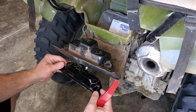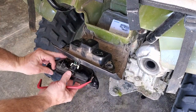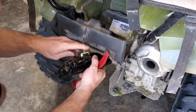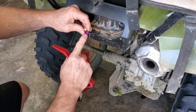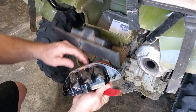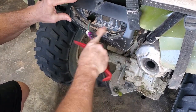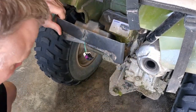There's the broken one — it's got one connector here that holds the light. You push this little tab up and it should unplug. There we go. It may be a little bit hard to pull out because it's got this rubber gasket here that keeps water from getting into the light. You can see there's a little water that does get back in here, so I might take something to clean this up a little bit before I put the other one back in.